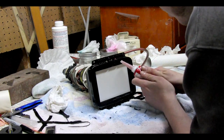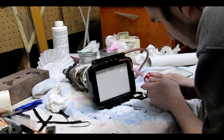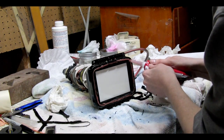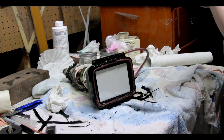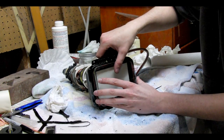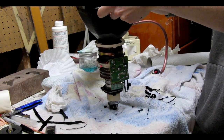When resealing the tubes, I used a high temperature RTV silicone from the automotive department — this is normally used for making gaskets in engines. When you reapply the glass, remove one of the screws from the metal housing. This will stop air pressure from building up and ruining the seal. Also try to stand the tube on end so that the glass doesn't slip around.